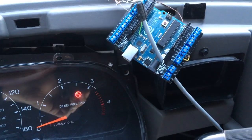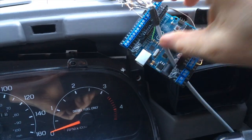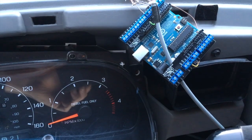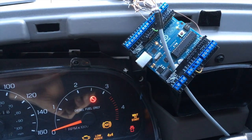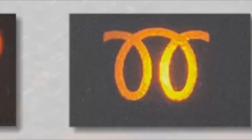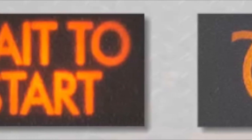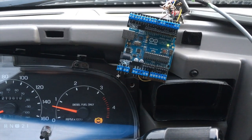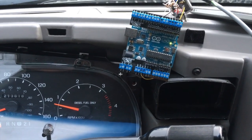I've cut the ignition key wire to the starter motor to avoid manual and unintended cranking of the engine. The device then waits for you to turn the ignition on and then for you to attempt to crank the engine with the key. Once it receives this start signal, it'll wait until the engine computer has completed the glow procedure. When glowing has completed, it'll run the starter using an external relay to send power through the cut ignition starter wire. Once the engine starts and revs high enough, the device will cut the starter — mission accomplished.